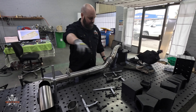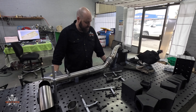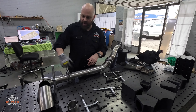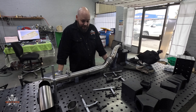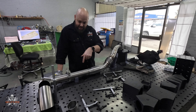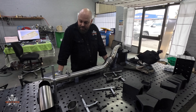Now I'm cutting out all the bends for the exhaust. Hagen has made up a whole heap of jigs - he's created these 3D-printed molds so I can put a bend in the band saw and it cuts off at exactly the right spots. When we go and put it up on the jig it all just goes together. Cut - perfect. The way he's designed it, they join together: cut one there, flip it over, and it cuts at the perfect angle. As you can see, that one's not even 90 degrees - it's probably about 95 or 97 degrees - but now we get that right angle exactly.